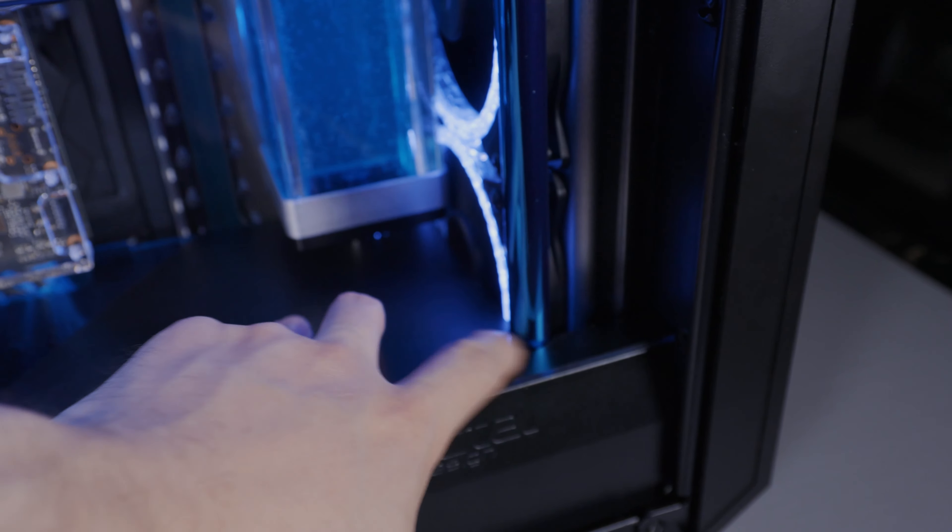A lot of people ask when you have two radiators: where's your drain? Well, if you want to keep your drain hidden — because they usually don't look that appealing — and you have a full PSU cover like this, your drain is going to be in the bottom. So my drain is in the bottom. In order to drain this, I will have to remove the PSU to get it to drain, but it's not a big deal — I do maintenance and take everything out anyway.